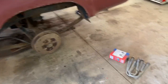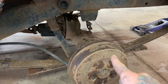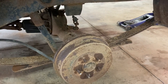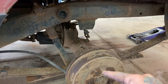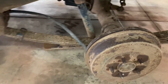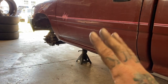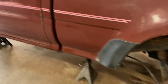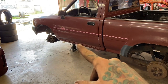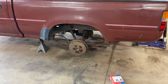For now, I'm going to start on the rear. I always like to start on the rear when I'm doing just a cheap static drop like this, because you're kind of limited on adjustability — pretty much by the size of the blocks and how many leaves you take out. Whereas the front, you'll see later, a torsion bar front end is fully adjustable. So I like to get the rear lowered, see where it's at, and then do the front, because you can pretty much put it anywhere you want it. Whereas the rear, you're kind of just stuck wherever it is.